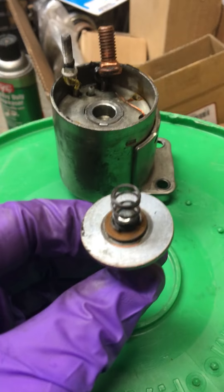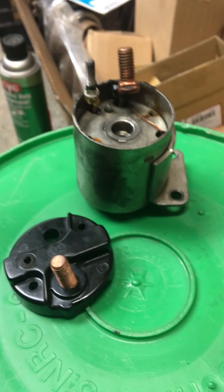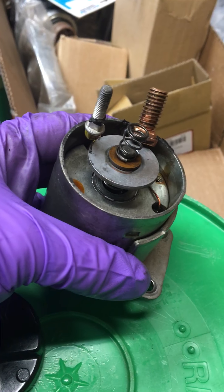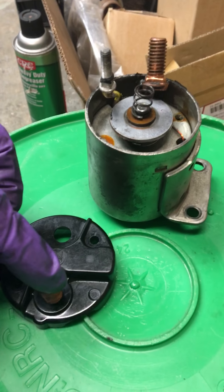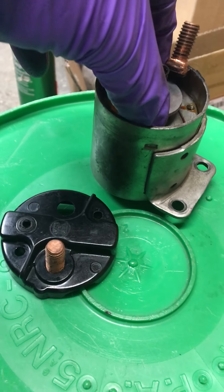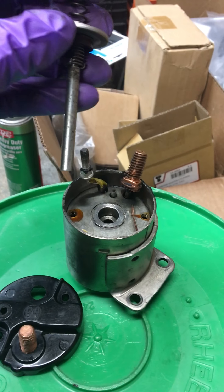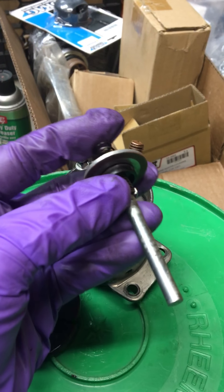What happens is this washer — when that plunger comes in it hits the stud when it bottoms out — causes this stud to actually move up. When this comes in, it causes this to push up just a little and contact both these studs, causing the current and voltage to go through this washer over to this stud into your starter motor. That's how these work. That's why if you ever touch this solenoid and cause that thing to pull in with your finger while your fingers are in that primary where the starter gear is, it's going to crank if the battery's connected.